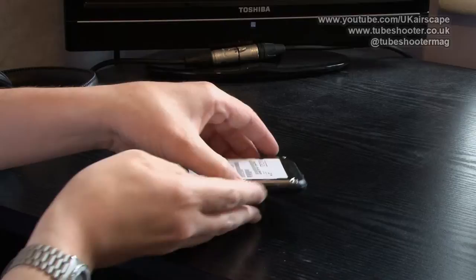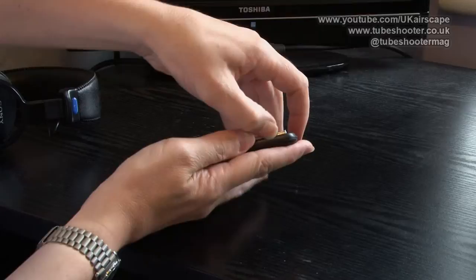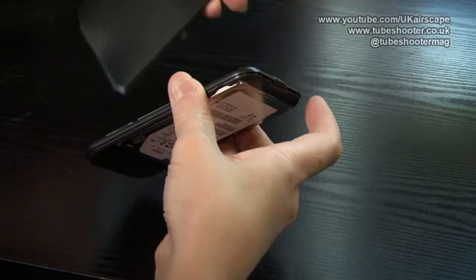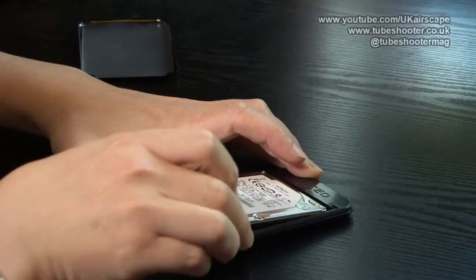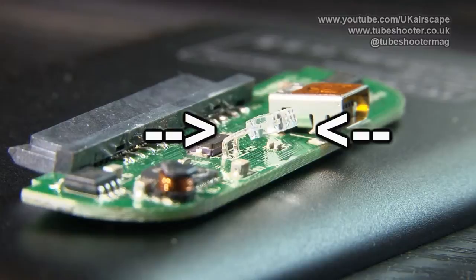Whilst it works okay, I would say you'd better be sure you want to put your drive in the case, because trying to get it out again afterwards is incredibly fiddly and you are likely to break it. There are two slightly recessed gaps in the case for you to try to grip the drive with your fingertips, but it's very hard to pull it out. You might try taking the other side of the case off as well and pushing the drive upwards slightly, but whichever way you do it you've got to be really careful because the drive is still attached to the case's circuit board while you're pushing it clear - so you're slightly flexing the circuit board and it is easy to break, as I found to my cost. You can see the USB connector here has come away from the board and the LED has moved a bit as well.